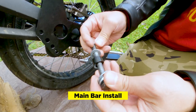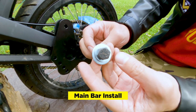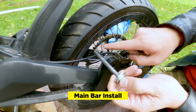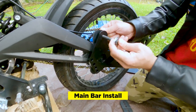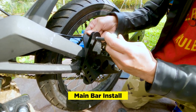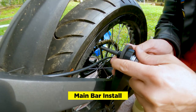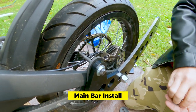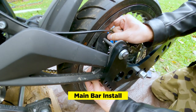Here's the bolt and nut. I have some extra washers — these didn't come with the kit, but I used three washers just so that the bolt sits further out and doesn't get too close to the wheel. The way this goes is you put the bolt in, then take the spacer and put it in between the swing arm so that when you clamp the bar on, it pushes out the rubber spacers. Then put the other two spacers on. Also make sure that you put the brake line above all of this — you don't want it sandwiched in between the clamp.